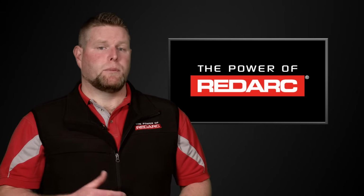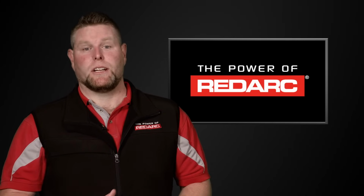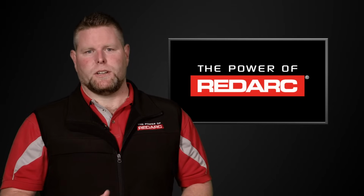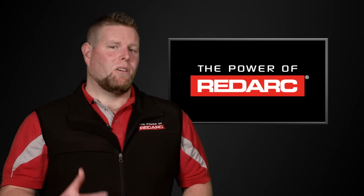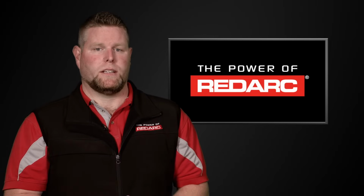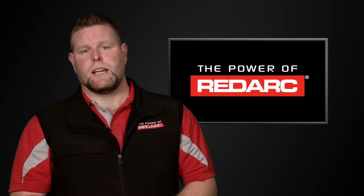But essentially, in proportional mode, if you brake hard and fast, so does the Tow-Pro Elite and so does the trailer. If you brake soft and slow, so does the Tow-Pro Elite and so does the trailer, meaning that the whole vehicle and trailer system all brake as one and you can get nice, smooth, progressive braking. The Tow-Pro Elite will also remember the last mode you used every time you start your vehicle.